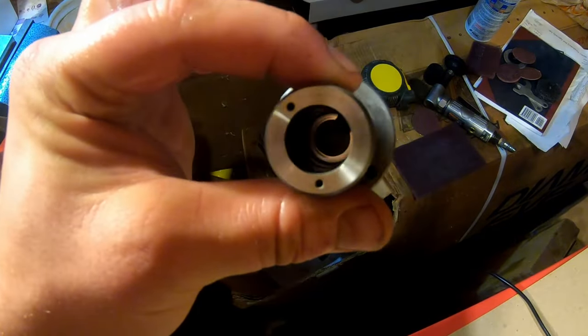All right, first thing I'm gonna do is take the nozzle and take the pin and insert it into the nozzle. It's very tight tolerance, but it should slide free. One of my injectors, because I had the order reversed of my cleaning process, that gunk built up. And so this was tighter, and I don't think that's good. So I had to take them all apart and clean them again. Your nozzle's in there.